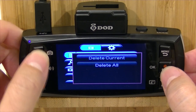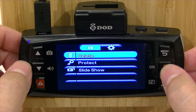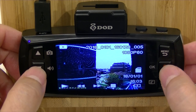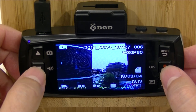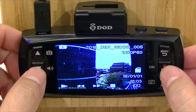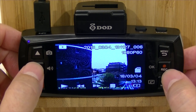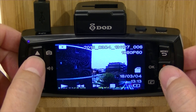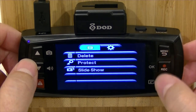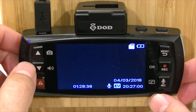We don't want to delete all — we want to delete the current. Push Delete this video, and that video has now been deleted. If we go back to the menu, you'll see we've jumped to video 5. Going back through the list, we've got number 6, 7, 8, 9, 10, and back to 5 — so that previously locked file has been unlocked and deleted. You can go through and delete your videos one at a time, lock or unlock them all. When you're done, push the mode button and it will take you back into standard playback.